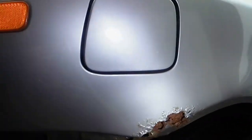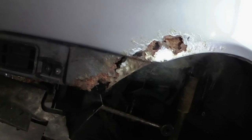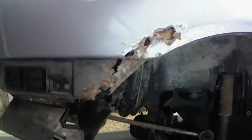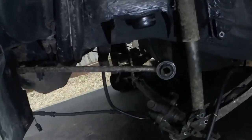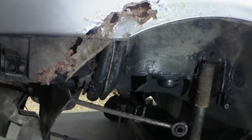And then I'm actually tempted to get the wire brush out and the flappy disc out. Let's get this bit cleaned up and let's get this piece repaired. I think that's a reasonably easy starting point to make a repair on, so that I can get an idea of how to get the welding working and things like that before tackling some of the trickier bits. It's also ready to go. There's not a lot that I'd need to do. The inner arch is out and all that kind of thing. So I think that's the plan of action. Let's get the suspension arm off. That'll give me peace of mind. And then let's have a go at cleaning this up and see what happens.